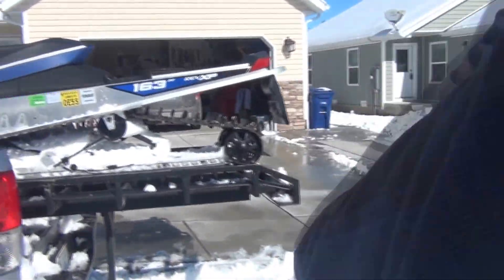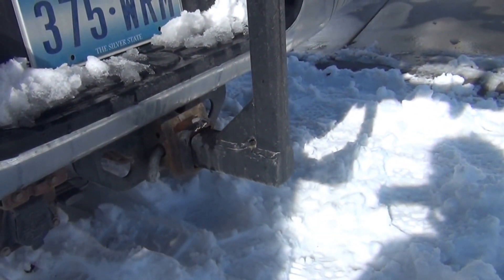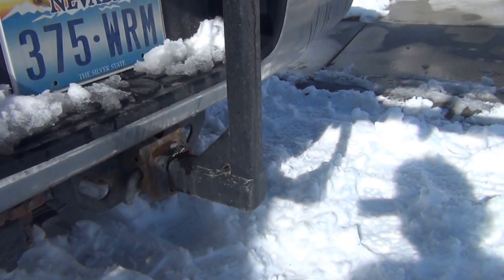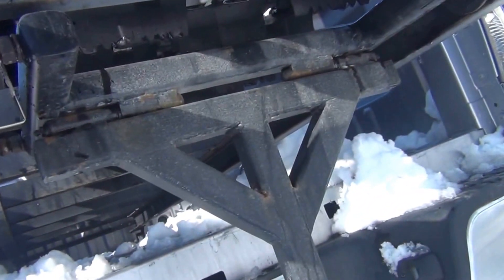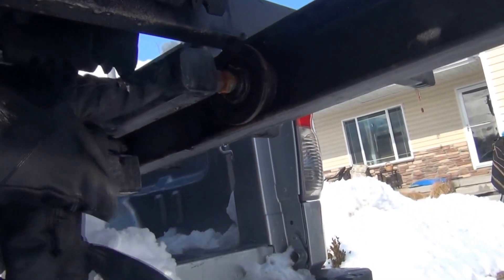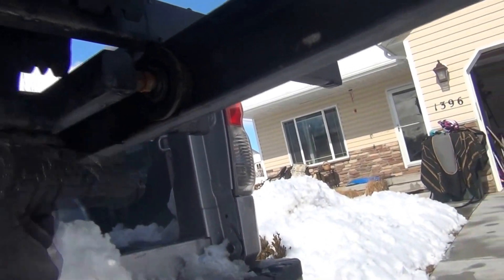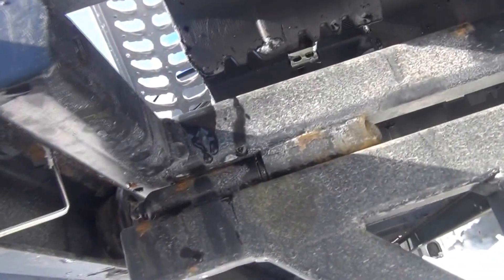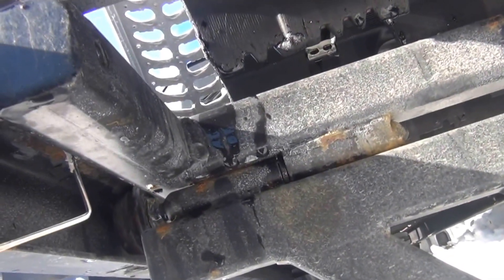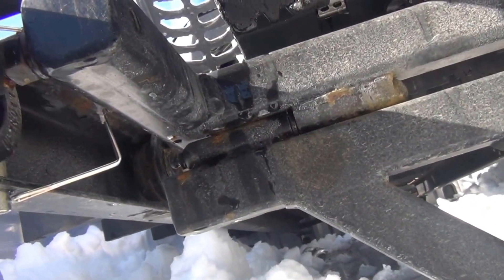You can see it's just a simple 2x2 coming out of the receiver hitch with a little bit of a gusset to strengthen it up. On the back you've got some 6 inch bullet hinges with grease that helps it flip around. These crossbeams here use a slightly thicker steel with a 2 inch bolt welded in place and ground down so when the caster wheel slides into place it has somewhere to go. This bolt is welded so you can tighten the wheel, and the locking nut just locks it in place.